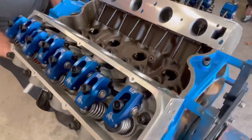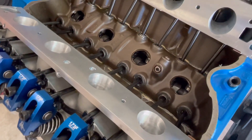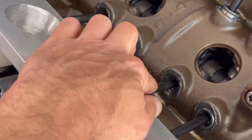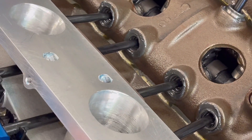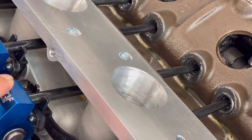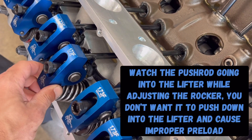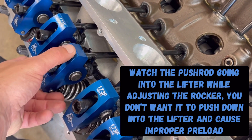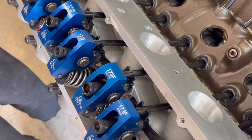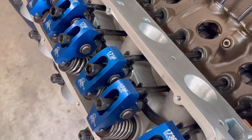What I do want to show real quick is what he's talking about with the actual movement. If you look down in here — if you're cranking down on that you'll see how that pushes — you can keep an eye on that. That's the bleed-down. When you're tightening this by hand, just make sure it's snug and do your quarter turn so you don't prematurely push that down. Always keep an eye on that. With that, we're just going to time lapse the rest — hope you learned something and we'll have a follow-up at the end.